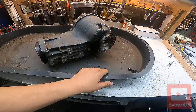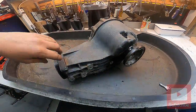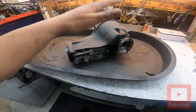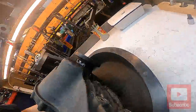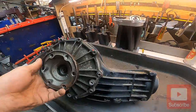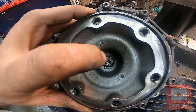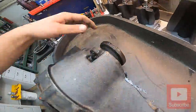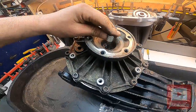Alright, we're back. I didn't want to make a mess so I got a drain pan. I've got all the mounts taken off now — you don't have to take your mounts off if you don't want to. What you need to first do is, after you got the oil drained out of it, there are these two allen bolts right down here — there's one on this cup and one on this axle cup right here.